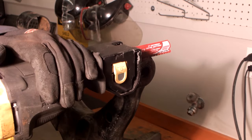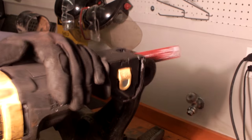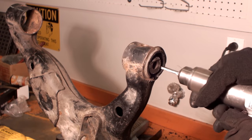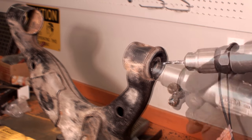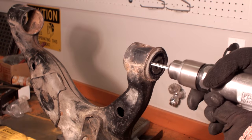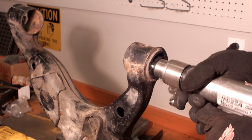Cut off both sides of the bushings. Now cut the center core of the bushings to remove the inner metal. This can be done by using a three-eighths or seven-sixteenths drill bit and drilling around the rubber between the inner metal and outer metal of the bushing.